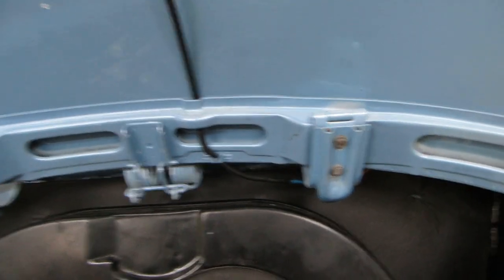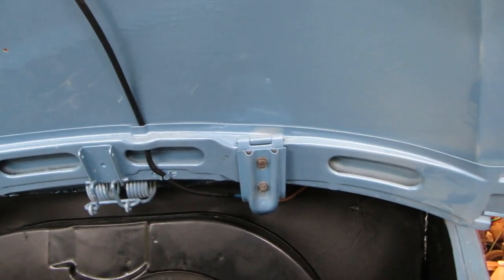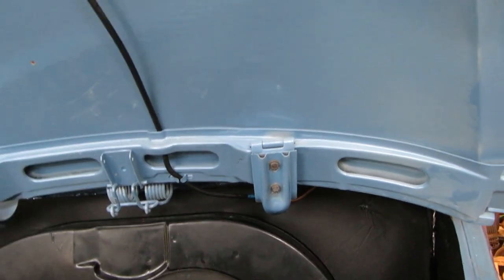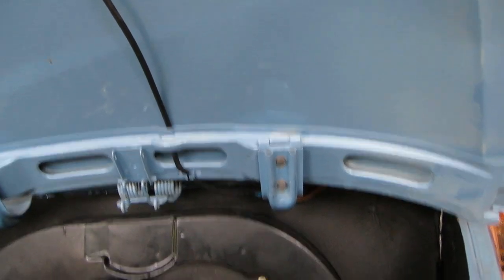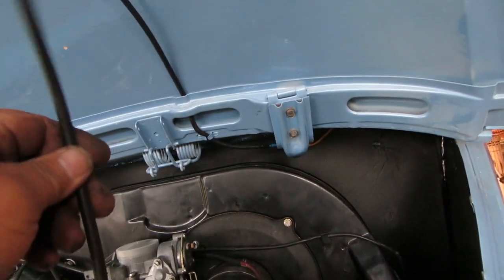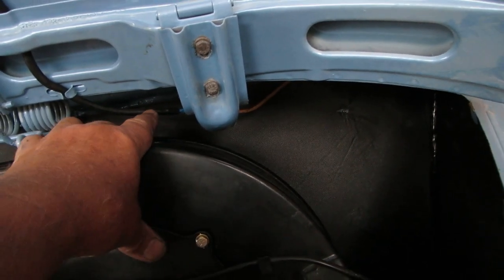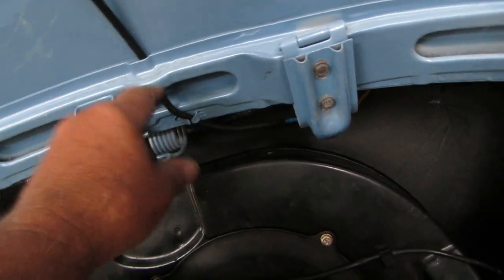I do a lot of glass work, that is auto glass, and we have hailstorms, and hailstorms put dents in cars and break plastic pieces, amongst which is cowls, the bottom portion of windshields. Did a lot of Ford trucks in the last hailstorm and replaced a lot of cowls, and every one of these cowls has this myriad of tubing for the washer solvent to go through. So you can run your wire for your taillight through some of that tubing and put it there. And don't forget, a lot of people don't put it through there. They put it over the top, but it goes through there.